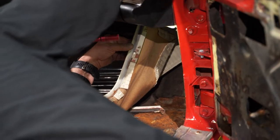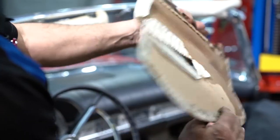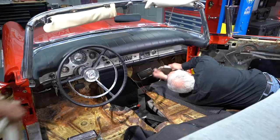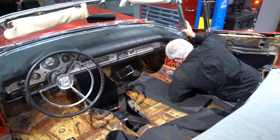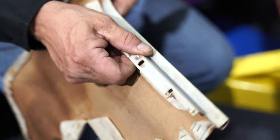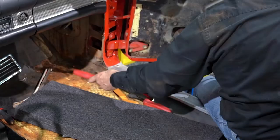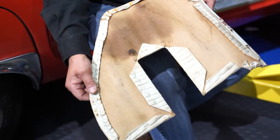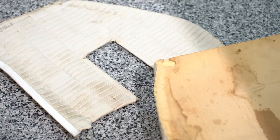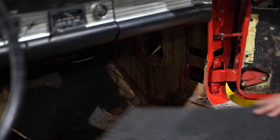I got my kick panel out. You can see the back is completely wet — it's pretty much gone. As you can see, it's just cardboard. We're going to have the upholstery guy make a new backing, recover the front with the Thunderbird bird on it, and we should be good to go. Doug is taking this out still right now. As you can see, it has a metal piece all the way along it and metal clips that hold it in. You need to take your time with one of the pry bars and slowly work your way through to get all of this out. You can see the back, once again, same type of thing — it got wet and it really destroyed everything.